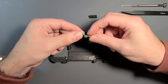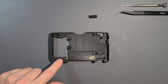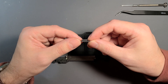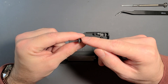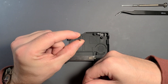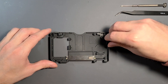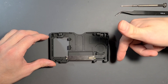This is the volume slider — make sure the notch is face up and push it all the way to the right, which makes it much easier later on to add the motherboard to the shell. This is the power switch; it has a slight overhang, and that overhang is the part that faces down onto the shell. Make sure the orientation for the power switch is set right, then slide it all the way forward as much as you can.